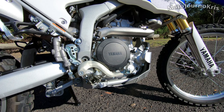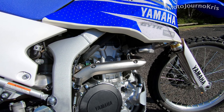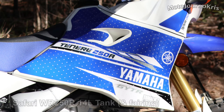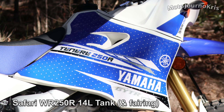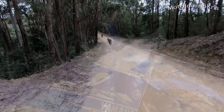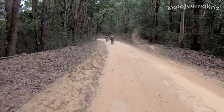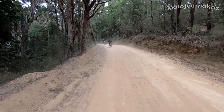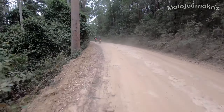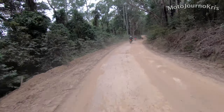A big aspect of the bike is the weight. At 126 kilos dry, it's not hardcore off-road racer light, but it is significantly lighter than a road bike, and the fuel tank is small at 7.6 litres, but you'll get exceptional mileage out of it, and there are larger tanks available for purchase. Keeping in mind that when the going gets tough, weight matters. When you drop a bike, weight matters. When you're looking at overall performance, weight matters. And when you think about rocky or rough off-road riding, that weight helps ensure everything works well, from the suspension to the brakes, as well as helping you as a rider reduce the amount of fatigue you're suffering.